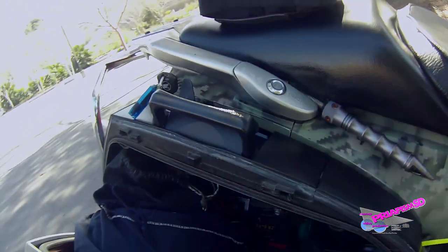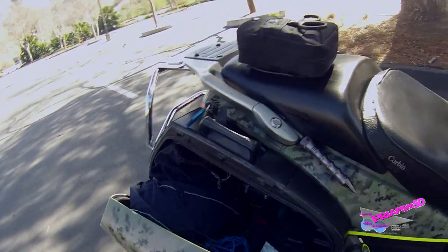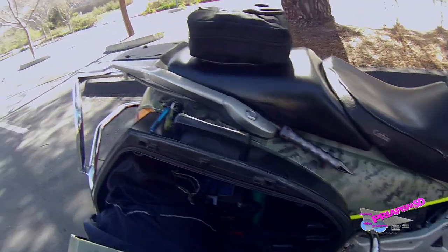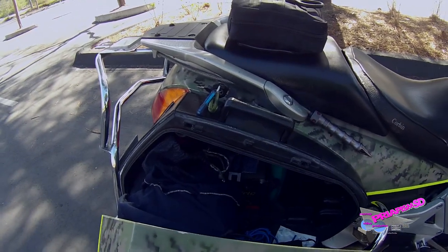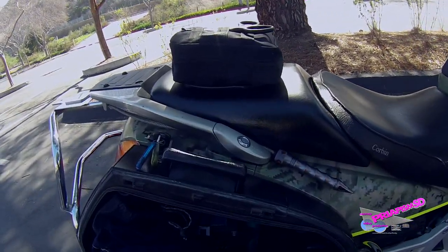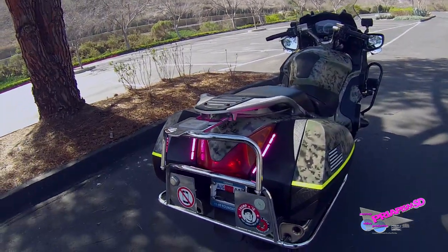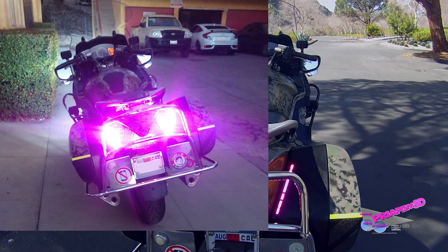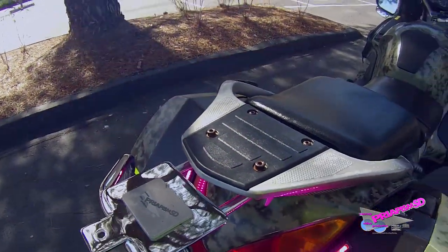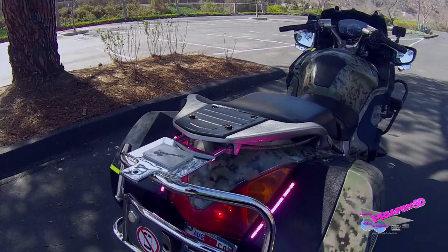The side effect is the leads go from the side of the saddlebag to the underside of the battery carrier, meaning this right saddlebag does not come off. So when you're switching the rear tire and need access to the bolts or the silencer on the right-hand side, you need to lift the right saddlebag to get enough clearance for a wrench, but it never completely comes off the bike — which also makes painting it a bit more of a pain. The rear tail light has decent visibility, but I wanted to add a bit more. CoB LED strips in the back are a quick $4 tap into the same tail light, although some of these Chinese models come with dead spots already. You get what you paid for, along with a slight heat issue apparently, but visibility is definitely crazy.